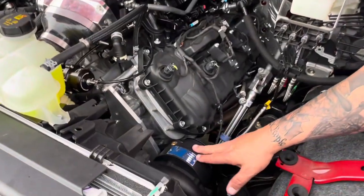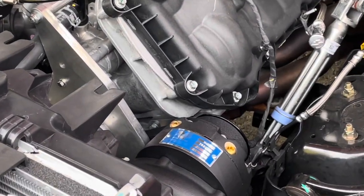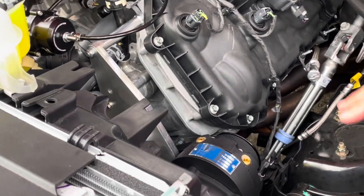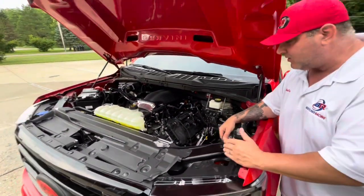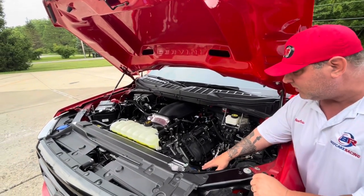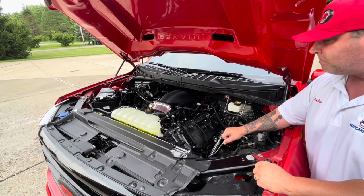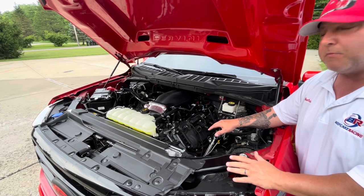Down here is the heart of it all — it's the Vortec V3 SI supercharger. This is the smallest entry-level supercharger Vortec offers. It does come with an actual tube and inlet and everything, but I like to just run an open filter because at the drag strip and on the dyno, we always pop the filter off — that's going to get you the most horsepower and it's going to run the fastest. We've run cars into the 7s with Vortec superchargers. All the head units, including the new V13, will fit in this bracket, so there are a lot of head unit upgrades if you want to make a lot of power. But we're going to throw it on the dyno today and see what she does with this basic setup.